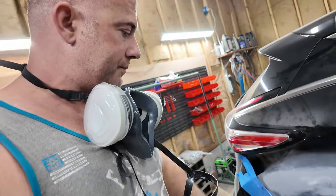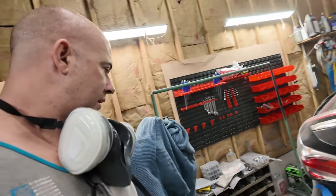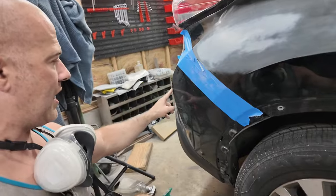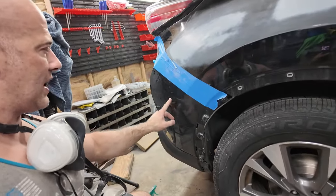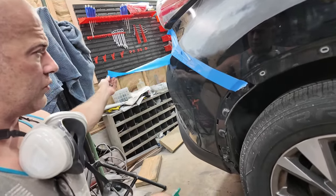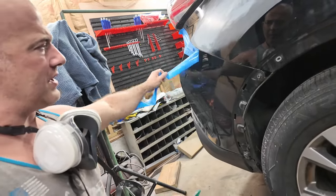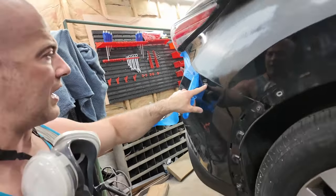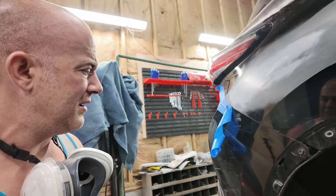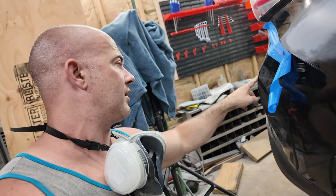There's also scratches on the bumper. We're leaving them be. I don't want to blend onto the bumper. There's really no clear spot where you could, like, you'd have a crisp line right here or something like that. I'm going to try to buff these scratches so they'll be less visible, but there's a really deep scratch, and it's black plastic under black bumper right there. I am going to build up some paint right there, and I will buff it, but that's down to bare plastic right there, so there's really nothing I can do about that unless I'm going to sand it and repaint it. But then you basically would want to clear the whole bumper after that.